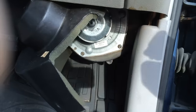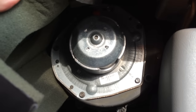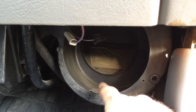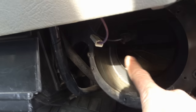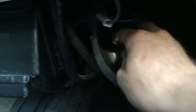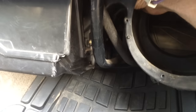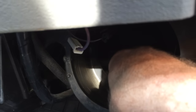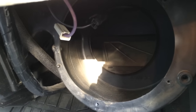Removing the two bolts at the top allows me to shift it over to the side and get access to all the bolts that hold the motor on. Once you've pulled the motor out, you can clean all the crud out of here. What it does is suck things down and blow them up into the heater and air conditioner area. Just reach up in there and pull all the crud out — looks like the previous owner may have been in there before me. Then stick a vacuum cleaner up in here and vacuum it out to get all the little chunks that might be stuck. You can see there are some plastic bits and other things in there that would have impeded airflow.